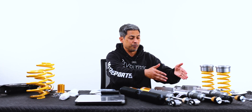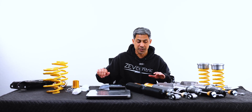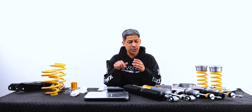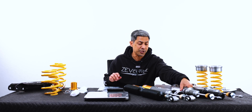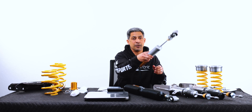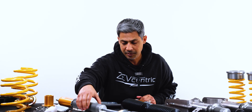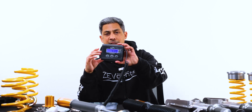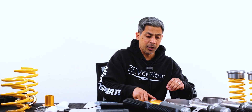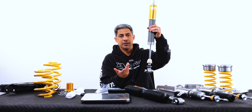Let's go over the contents really quickly. You've got your front coilovers here — your front dampers. The spring perches are already installed. Everything is exactly like this out of the box, except I preassembled the rear spring height adjuster. You've got your front shocks, your dust boots, and some plastic thrust sheets. You've got your rear dampers here. Keep in mind these are all aluminum — crazy lightweight. This is how light it is: 4.2 pounds. All aluminum, amazing stuff, made in Sweden. The rear damper is inverted, which is also pretty neat because the adjuster ends up on the bottom, so you can get to it without having to jack up the car — you can just lay down on the ground and get under there.